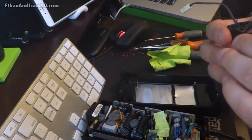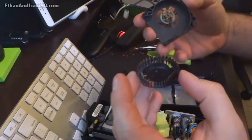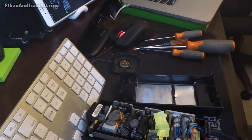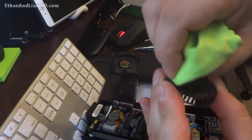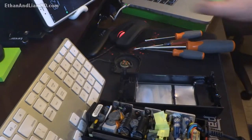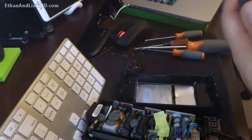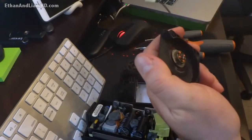Pulling this portion of the fan out, you have to be really careful. You just pull it straight up — it's magnetic and brushless, so it's not physically connected with any screws. You just pull it straight out and it should come out. It'll feel a little bit tight at first but it'll pop off with no problems and won't damage anything. You're going to notice all the dirt and dust underneath it. Take that same cloth and clean every bit of it as thoroughly as you possibly can. Don't use anything wet because there are magnets inside and they may rust and cause further damage. So make sure it's a dry cloth and clean every little detail of the fan — specifically the surfaces that touch other pieces of plastic within the fan housing.